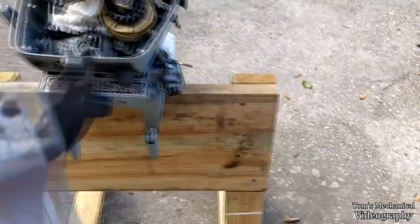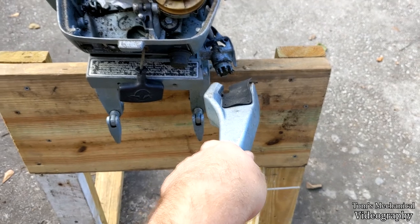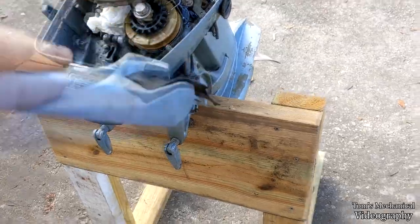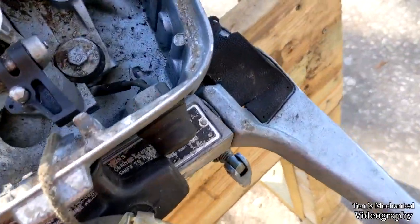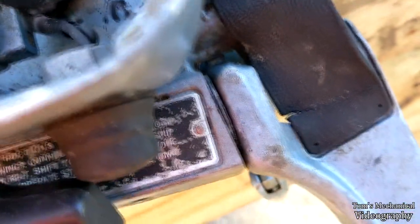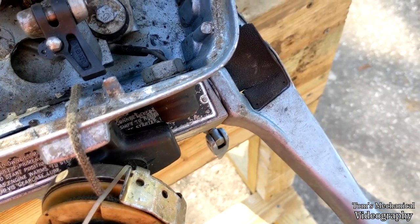Tiller arm's off. Just FYI — that bolt is threaded, which I think is totally unnecessary. Once you get that nut off, you need to put a ratchet on the back of that bolt set to loosen. Actually, future Tom to past Tom: there's a hole over here, so you can actually take this tiller arm on and off way easier with about nine inches to a foot of extension. No reason to fight it. Don't listen to past me — he was stupid. Otherwise you slowly wrench it off and it takes forever.